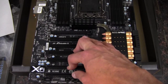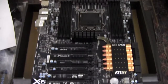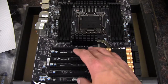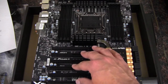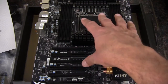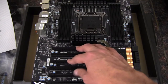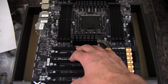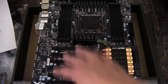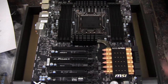Perhaps it's something they're leaving open, maybe for a BIOS update or a new i7 chip that will have more PCI Express lanes, and at that point maybe you can utilize x8 in the 2.0 slots, the even numbered slots. So maybe they're wired to 8, but right now the Intel CPU only supports x1. Maybe there's just not enough lanes. Because if you had 16, 8, 8, and 8, that's 16, 32, 40, 41, 42, 43. You'd have 43 lanes of PCI Express if you were able to actually populate all of them. So I guess that's probably why it needs more lanes before it would work that way.